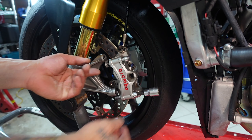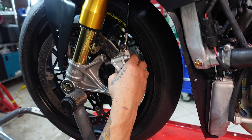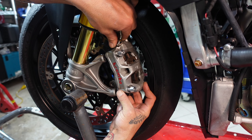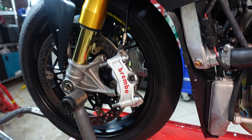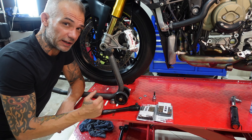Make sure you don't lose this. Give it a good play and pull it out sideways and back. We're going to do the same on the other side. Once we've done both calipers, it's time to remove the wheel and get it out of the way.